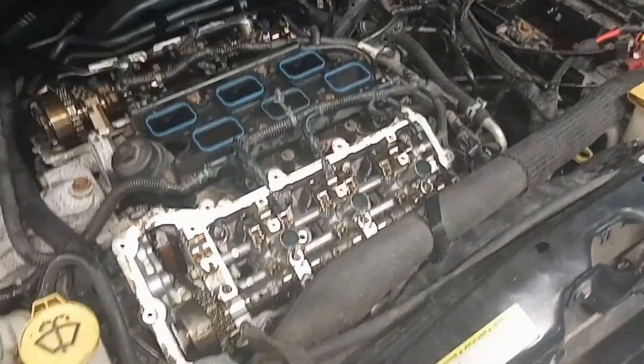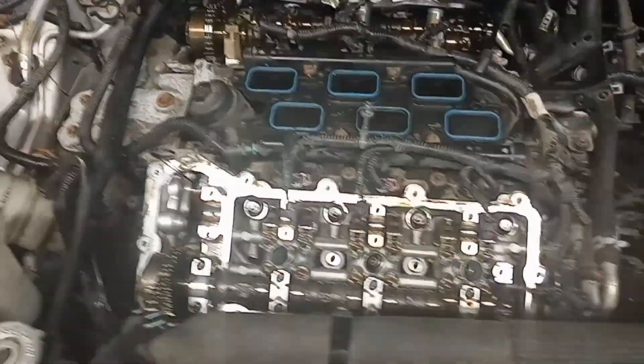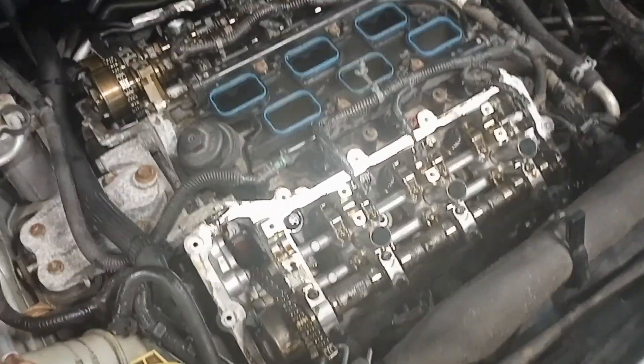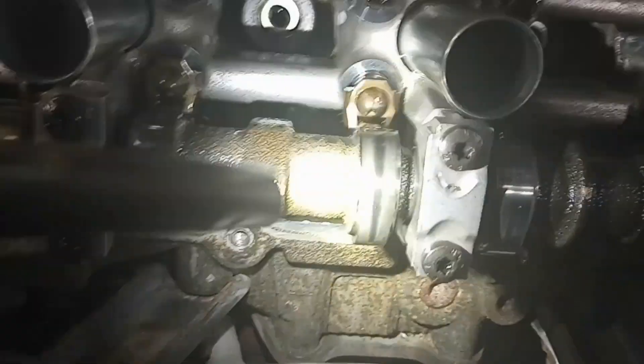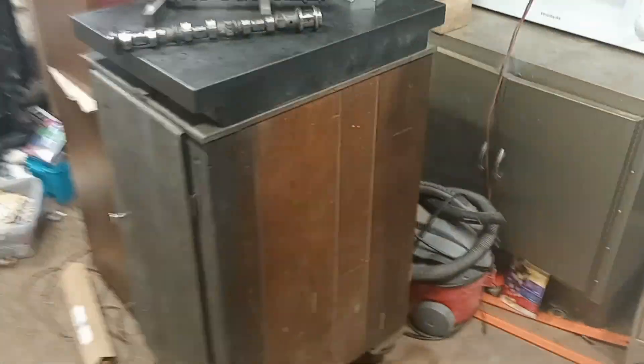This is a little out of my normal video making field. What we've got here is a 2012 Dodge Grand Caravan with a 3.6 liter Pentastar in it, and it's got the classic wiped out cams issue. Somebody ran it forever. You can see a cam lobe that's smeared off on the sides, and there's another one that's been wearing bad. This engine got run with the death tick in it for a long time. Took the cams out.